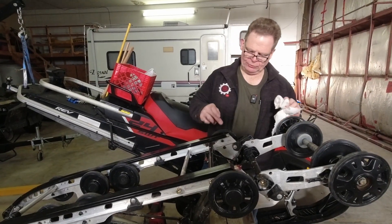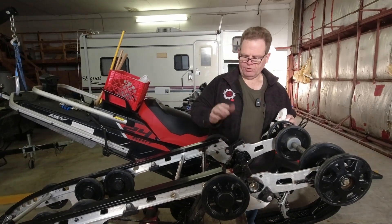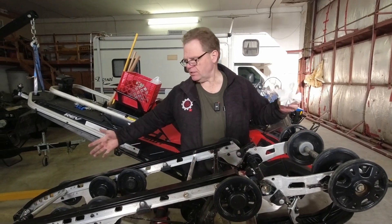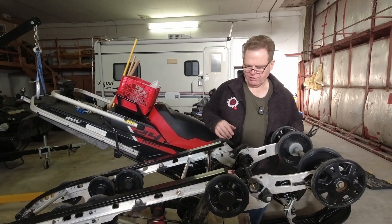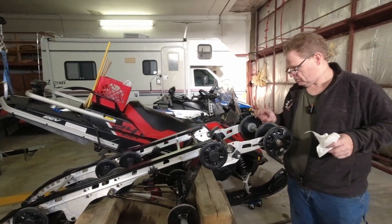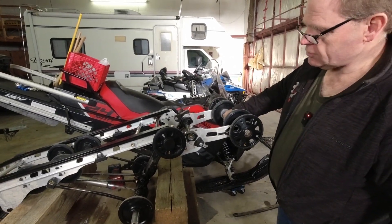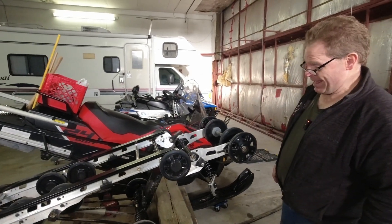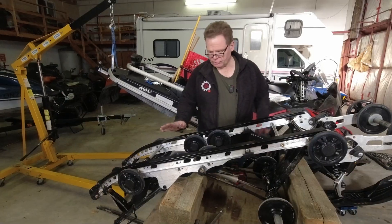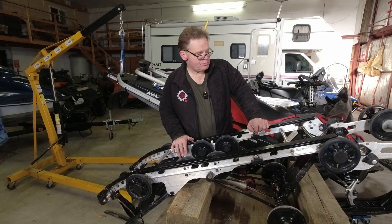There are people that pull these out through the track window - they won't fit through a track window horizontal, but if you turn them vertical they would fit. But pulling the slide cage out is an opportunity to give everything a good look over - we can look at all the wheels and make sure we don't have a bearing that's about to go. If we had a grease gun, we could grease everything up. It's not a bad idea to give everything a good inspection - make sure nothing is going to fall off. Having a slide cage failure would be a bad day out on the trails, especially the way we ride out in the middle of nowhere.